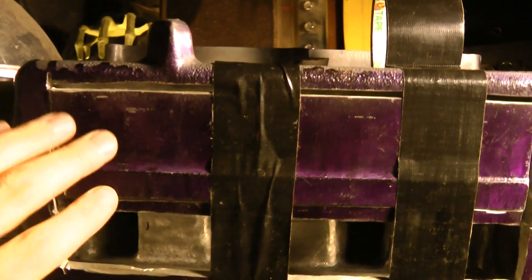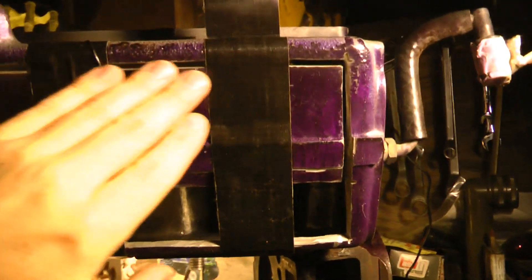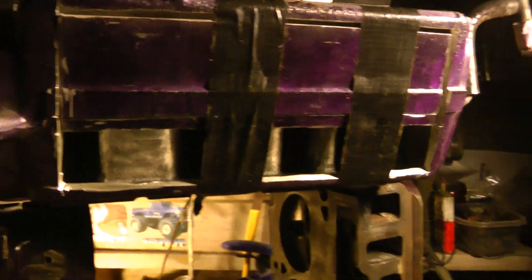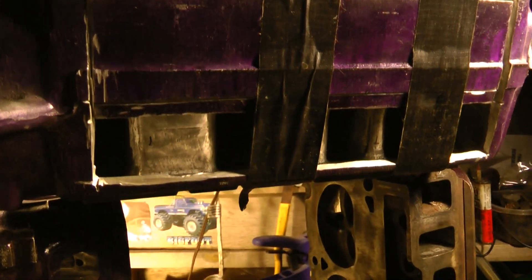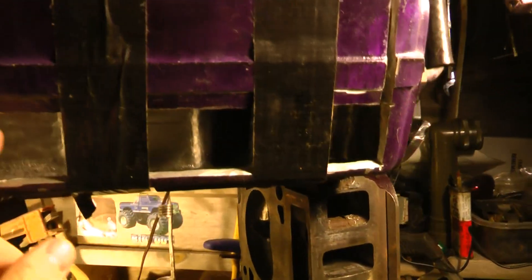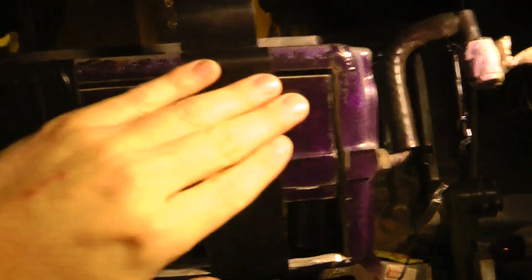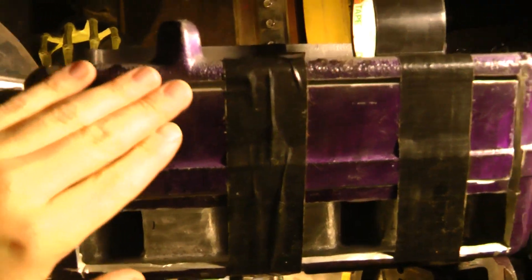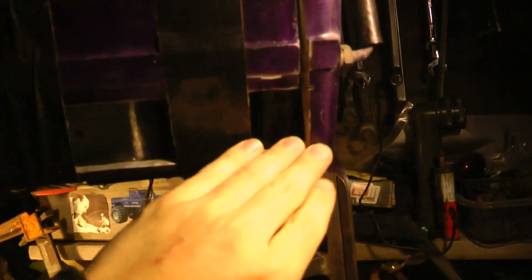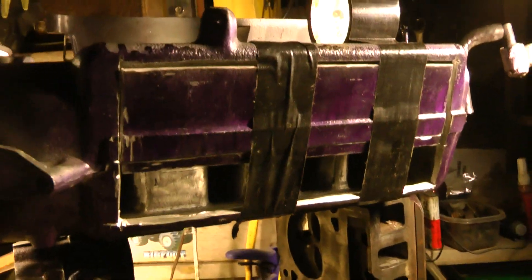So the plan is: epoxy first, then I'll probably go around and make some welding lines, because I don't know how well that flux core is really going to do. But I do want metal on metal as well. Then when it's all stitched together, I'll probably take another layer of epoxy — maybe just like a sixteenth of an inch or so — to make sure there's no air leaks or anything like that. And that's pretty much how I figured I'm going to do it.